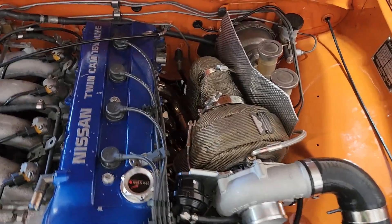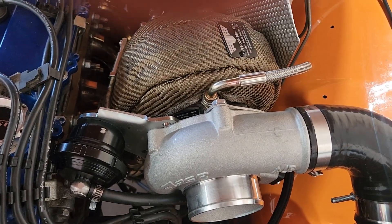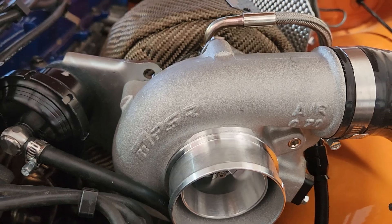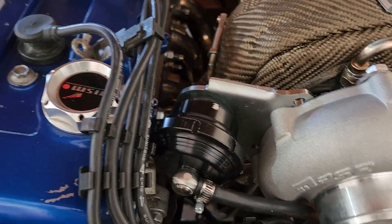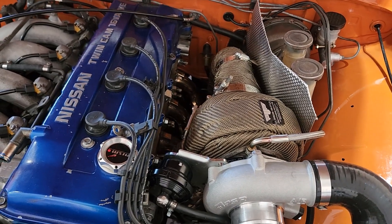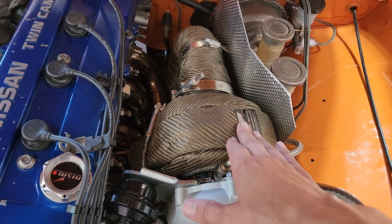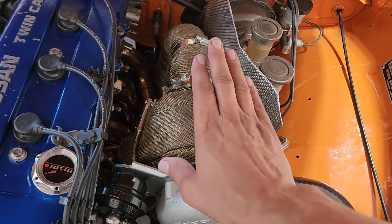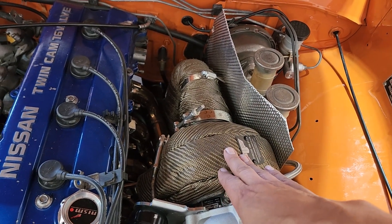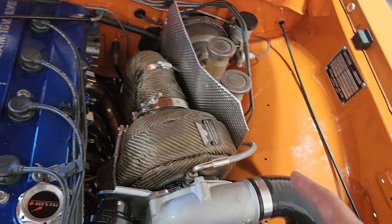I'll try to give an overview. I have a CX Racing top mount, 11-gauge thick manifold. I have a knockoff turbo — it's a knockoff of a Garrett G25-550. This is a Pulsar or PSR 4849G with the internal wastegate. I chose that because of space issues. I figured the external wastegate was going to cramp a lot of space, so the internal wastegate simplified things. I bought a PTP turbo blanket for a Garrett G25-550 and put that on — this thing works amazing. Even if you didn't have a heat issue, I would still run this just to keep the heat down. We have the downpipe that my buddy Joe and Nick made, wrapped in some heat wrap.